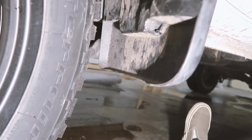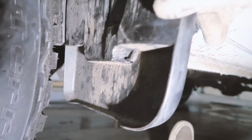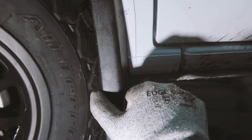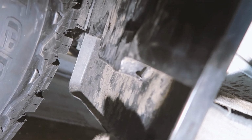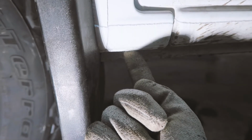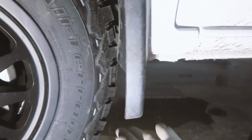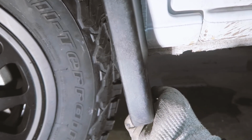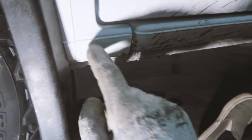It's a little dark with the camera, but I'll try to show you exactly where I put that screw. It's really hard to get this shot, but you can see the screw head right there when I'm out of the light. So all you've got to do is hold back this mud flap, because you see this still moves quite a bit. Hold it back with one hand and then get that screw straight up through, and that's going to go right up through this fender piece that we cut and hold the mud flap back. So it's super important that you grab this. You could either wedge something in here or whatever you've got to do. Make sure the mud flap's all the way back, and then set that screw straight up into the fender here. Let's do that now.